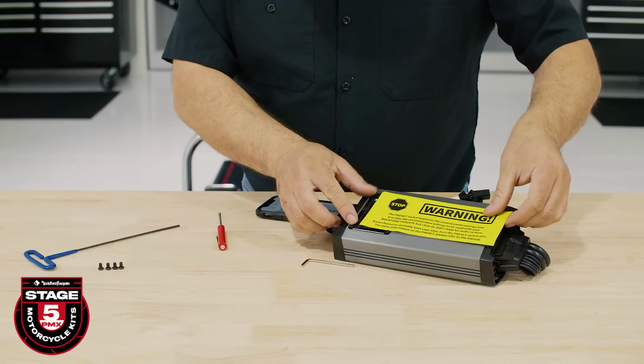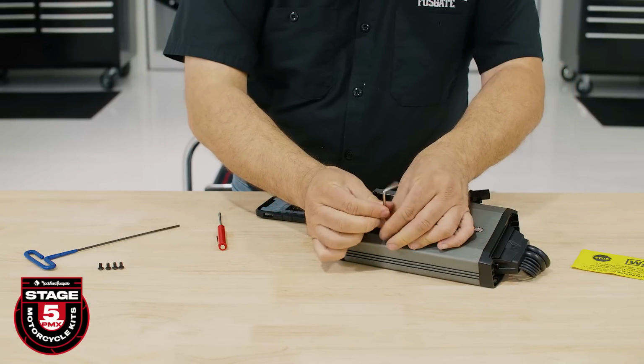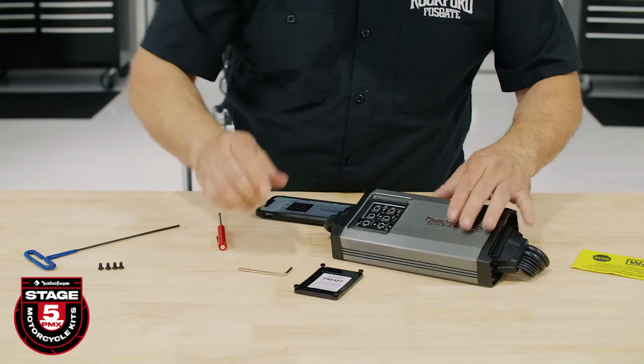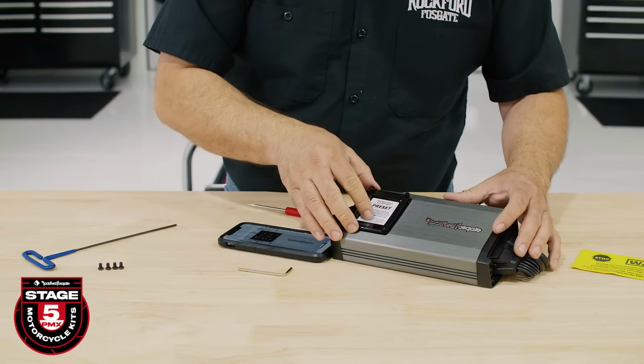Now that we're done with that, we're ready to tune our amplifier. We offer an amp tuning guide that's available in the description of this video and through this kit's product details page at rockfordfosgate.com. Use the included 3mm Allen wrench to remove the control cover. Then use the tuning guide to verify all your settings are correct. Minimal adjustment should be needed to tune the amp. Once done, reinstall the cover.